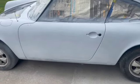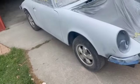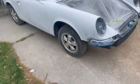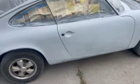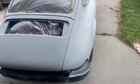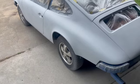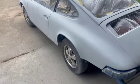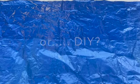Going to block it one more time with 400, go all around and prep it for paint. Body work took a couple of months — the weather's just now getting warmer, able to get out in the shop. This is the last piece we need to work and get ready to go. Feather fill was not fun — it was a chore. Blocking, sanding — but if it pays off, it pays off. We need to get some paint mixed, get a booth, and get the car shot. There's your 1971 911E update.